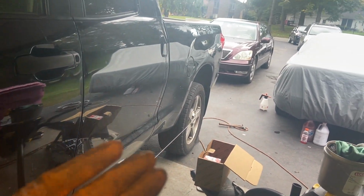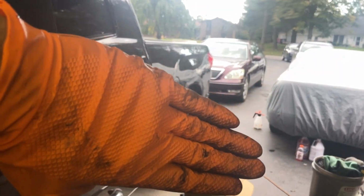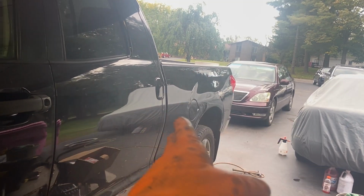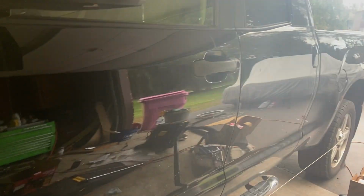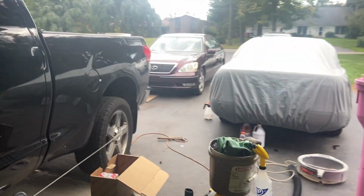So if I find that I'm off, I can drive the truck down my very long driveway. It's like 10 cars long, maybe, whatever, six cars. Point is, I can drive the truck totally straight. The steering wheel will be one spline off because I'm at least that good to get within a spline. I would then be able to shut off the truck, disconnect the battery, take the steering wheel off along with the airbag and the clock spring, move the steering wheel one spline so it's correct, and everything would at that point line up, because again, there are only so many splines. I would then put the clock spring back on, the steering wheel back on, and the truck would never know, unless the steering wheel position sensor is not in the clock spring. If you happen to know that about Tundras, this 2008 Tundra, go ahead and drop it in the comments. Hopefully I don't have to find out, but if I do, I will post back.